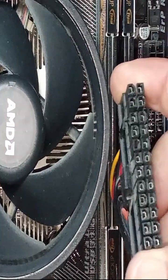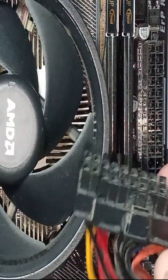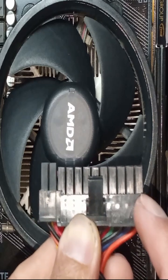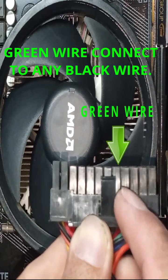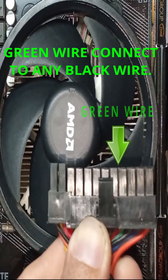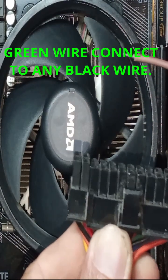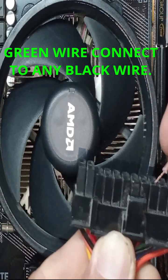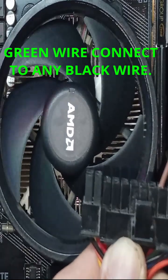You should also check the cables and connections from your PSU to make sure they are connected correctly. Take your 20 or 24 pin connector and locate the green wire. There is only a single green wire, so it should be easy to find. Next to it should be a black wire. Take a paper clip or short wire, bend it into a U shape, then insert one point into the green wire slot and the other point into any black wire.